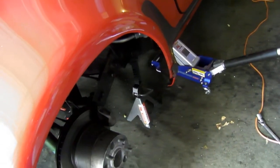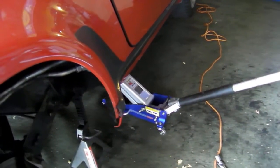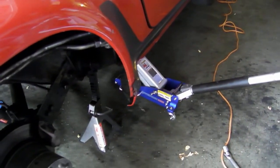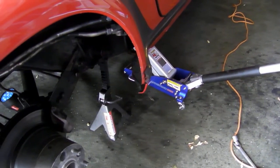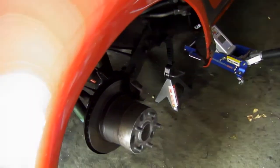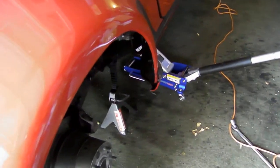Moving over to the underside of the car — please make sure that you're safe with your jack and the way your car is raised. Always use a jack stand, and keep some pressure on the jack just in case the stand fails. We are in California, earthquake country, so make sure this is safe and secure. And even if you're not in earthquake country, the car wiggles a bit when you're taking this off. Also — very important, actually the most important step — make sure your battery is disconnected.